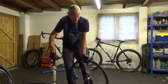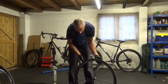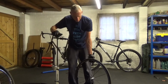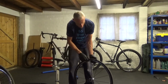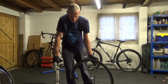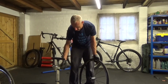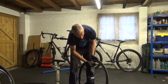They just feel funny to start with as you're blowing them up, until they get expanded enough to actually push. You don't think it's going to seat the tyre to start with, just because of the material it's made of. But once you get a few pumps into it, like so, get it blown up. That's 70 psi in it, so you can blow up more than that, just make sure it's popped on. Get a few more in there, so there you go, 80 psi in it. And it's just a case of doing that, put your valve cap back on, and there she is installed.